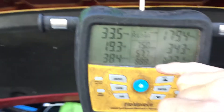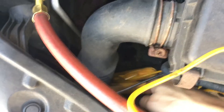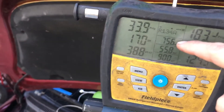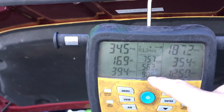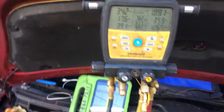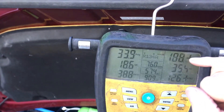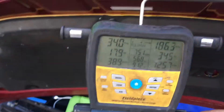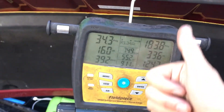If you come to our liquid line temperature — the temperature of the refrigerant coming out of the liquid line — I have my clamp right there on this liquid line. Here's the outside temperature taken right here going across the condenser, and here's our liquid line. So we got a 15-degree drop in temperature in these working conditions. The system is experiencing a load because of the higher temperature air — I went from recycle and turned it to fresh air. So now it has a higher load and has to work higher, so you see the high side pressure going up.